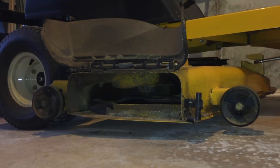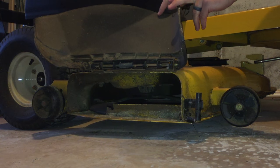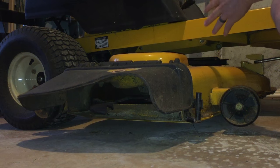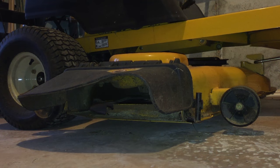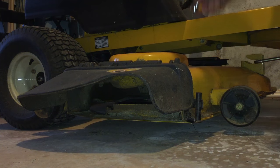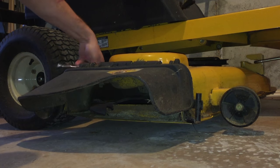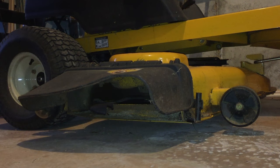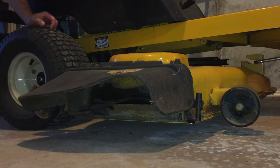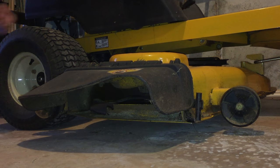The first thing I'm going to do is a little troubleshooting. If you remember, I rigged up a little hook because my mower deck barely fits through my French doors to get to my basement — I drilled a small hole in the chute and hook it to the belt shroud, but I take that off when cutting so that shouldn't have caused the issue. I'm going to remove the blade guard first. It has three bolts on it — they are 13 millimeters — and there's also a bolt here that is 10 millimeters. So 13mm for the main three bolts, 10mm for this one.